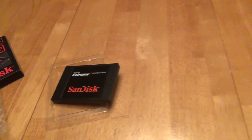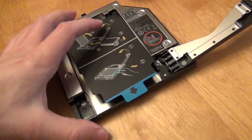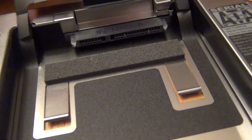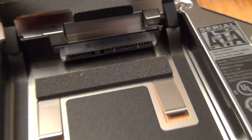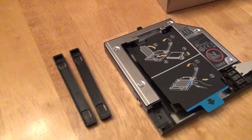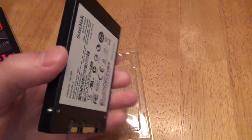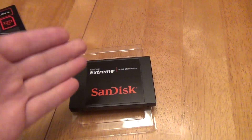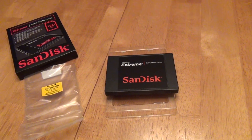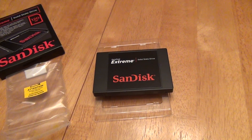If you're dealing with a laptop like I am, I have a replacement for my optical disk drive bay. You don't need a cable with notebook computers because you just slide it right in. Or if you have a bay inside your laptop, you probably don't use cables either — they just slide right in. So assuming you have a bay to install into, you just put it in and it should be immediately recognized, though not initially with a drive letter. It doesn't come formatted, and that's standard — you're going to have to format it yourself.